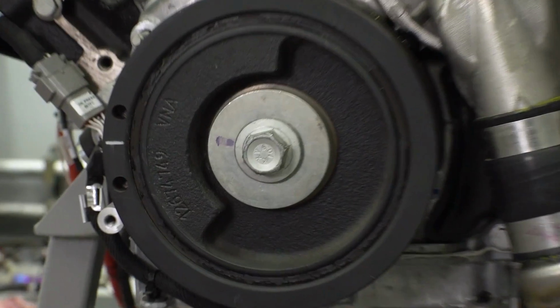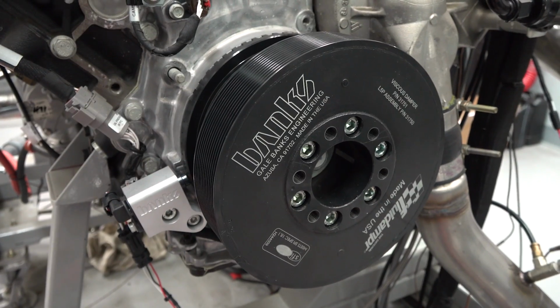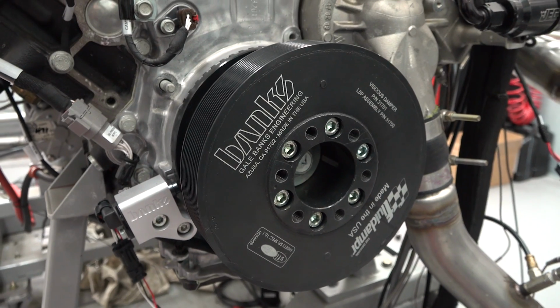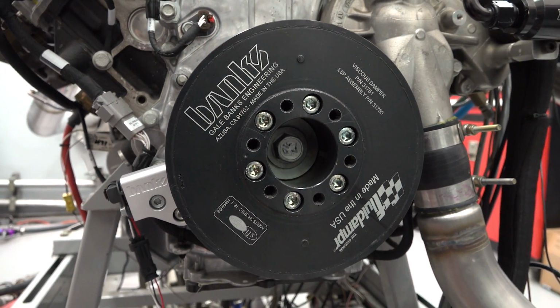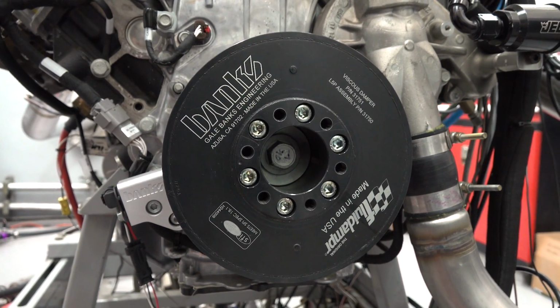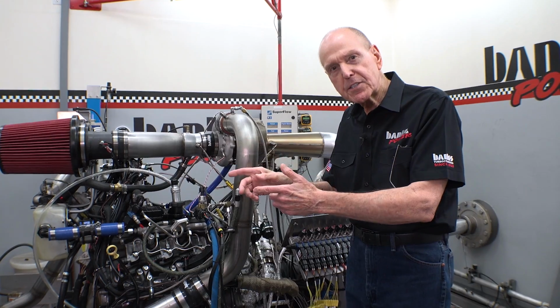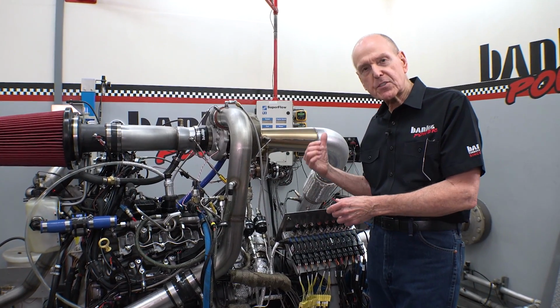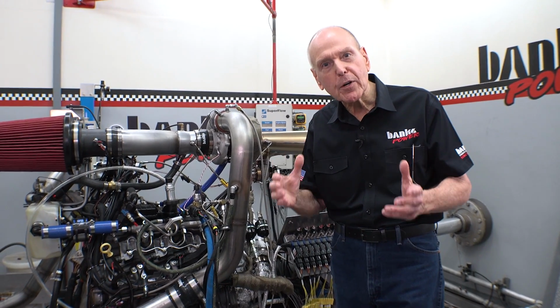We also replaced the worn-out rubber vibration damper with a viscous fluid damper so we don't break the crank. And we've also rigged it to measure crank twist. More on that in an upcoming video. So we did all this, the vibration damper, the air intake, the up pipes, the exhaust system, all to try to find power where most people don't look.